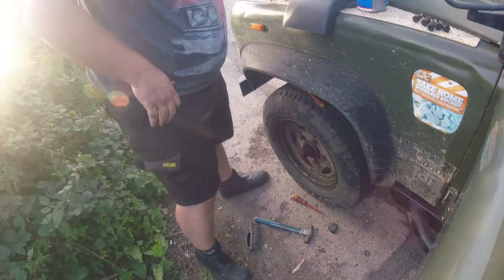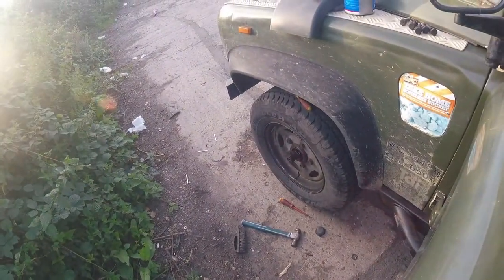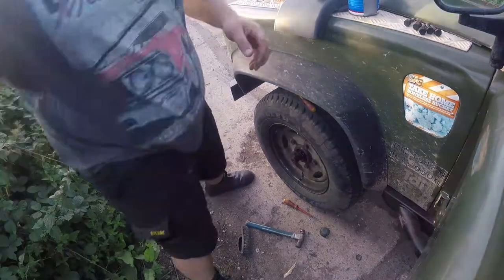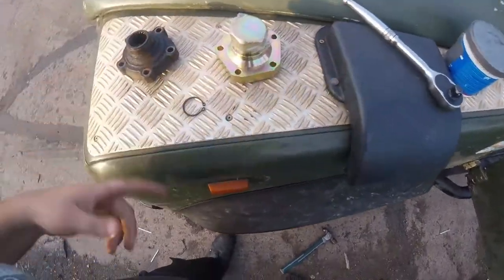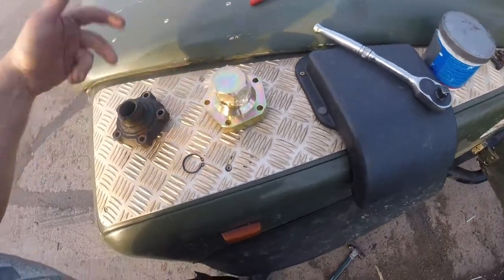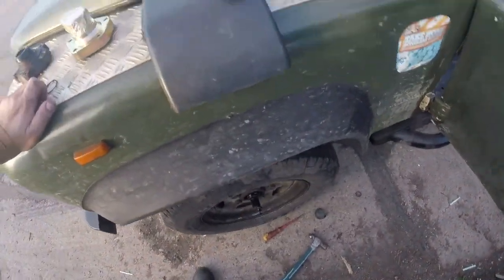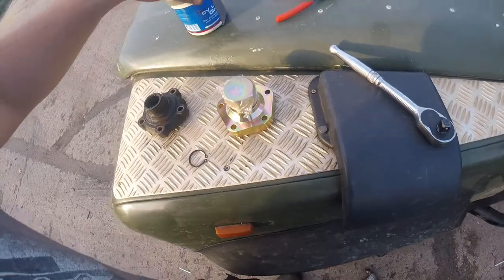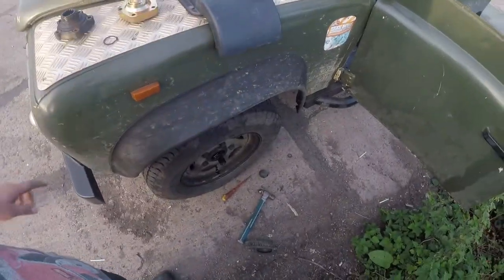I'll stick it up here actually, do a little comparison — nice new shiny one. So there we go, we have the old one. That's the circlip — I was using the wrong nozzle bits, so I put the other ones on and it worked. That's a nice new one going on. There is a rubber o-ring that goes in there, so crud doesn't get in and to prevent any cross contamination. I'll be cleaning that up and smothering it with CV grease — the tub's got a split in it, hence the duct tape. That is one removed.